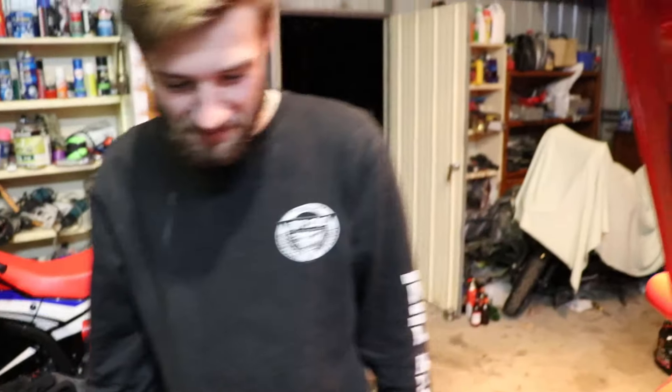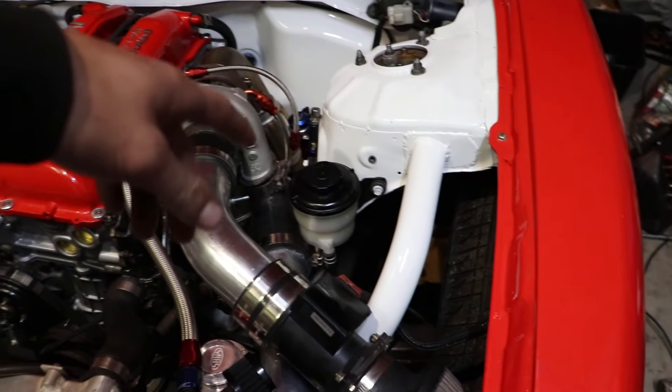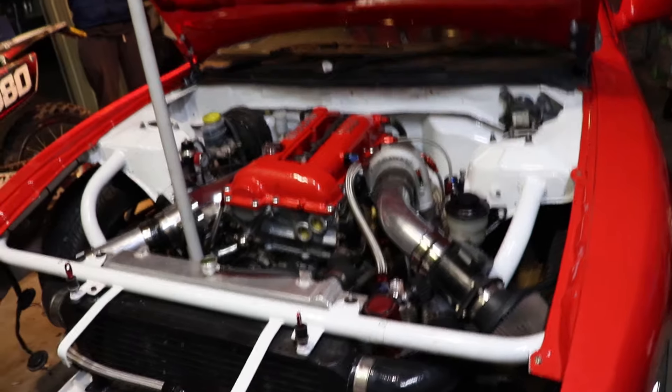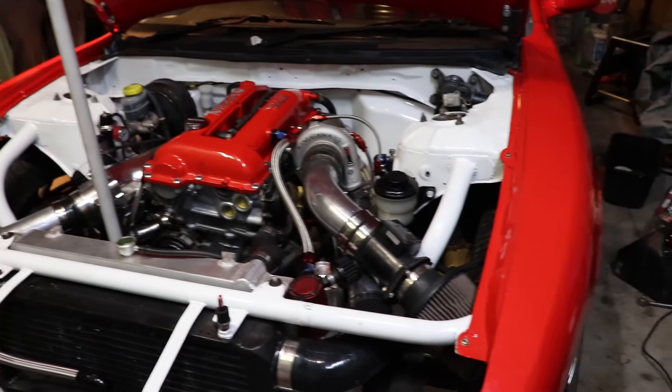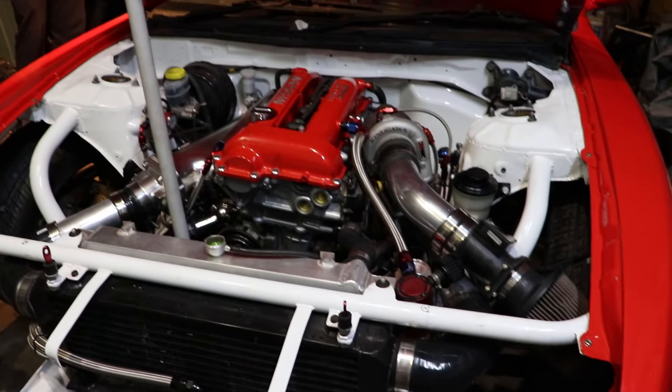That's sick - builds a motor and it works! She's alive again, fucking over the moon. Stoked to see it running again and see all the hard work finally paying off. She seems to be running pretty damn smooth. The squeaking sound was the power steering because there was no fluid in there, but I dropped some in and it went away - seems pretty buttery smooth. The next video will be me taking it up the street and breaking the motor in, getting those piston rings settled in. Once I've broken it in, probably gonna be throwing bigger injectors in it and going to get a tune - probably turn the power up a little smidge more. It's at 250 rear wheel kilowatts at the moment but wouldn't mind squeezing just a smidge more out of it. Not too much though, because I'd start breaking the gearbox and everything else behind it. That'll be it for this video - thanks for watching. Make sure you hit subscribe and like and leave a comment, and stay tuned for when I break the motor in.